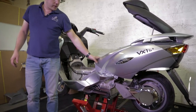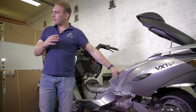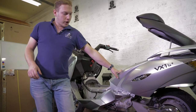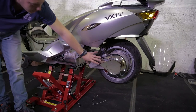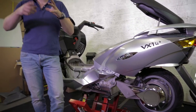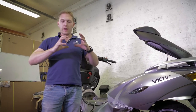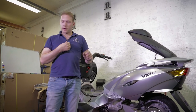This bike has a very precise regulation of the power. It's very smooth due to a very precise encoder. The encoder is located here on the back of this cover and provides feedback to the motor controller about the position of the rotor. The motor controller, knowing the position of the rotor, can properly adjust the magnetic field to properly manage the motor.